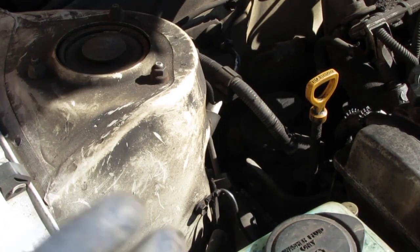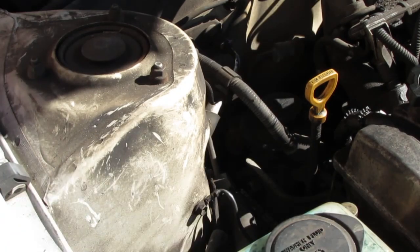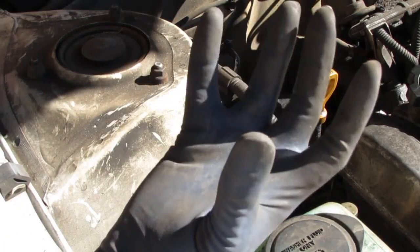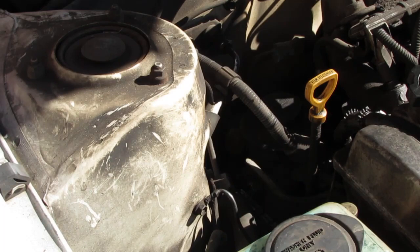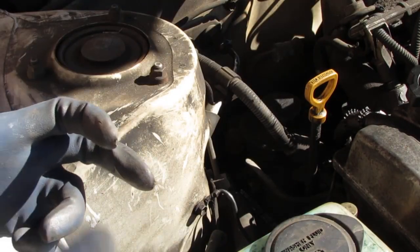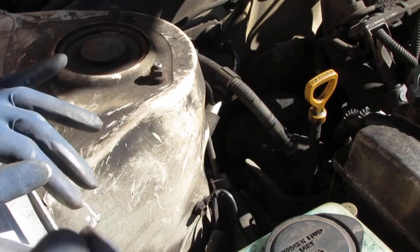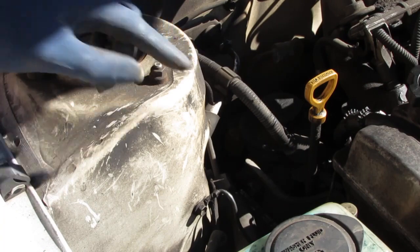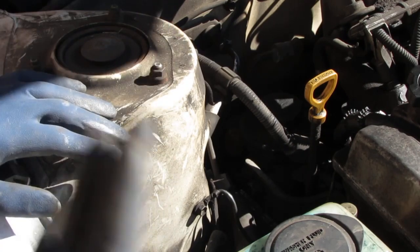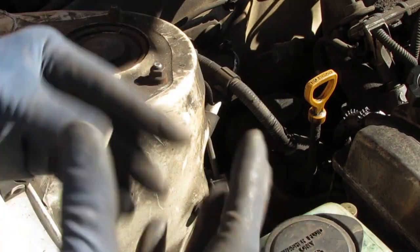Okay, so anytime you have a system with moving parts, there are bearings that fail, and pulleys, and you have belts. All these things can create that sound, right? And initially my diagnosis was those common failure points for something like this. I've heard it before on multiple cars, and it was always the belts slipping.